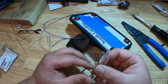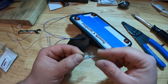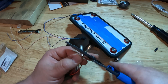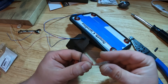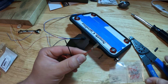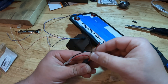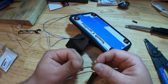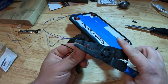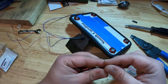You're going to take one of your resistors — obviously you're not going to be able to squeeze a tiny 24-gauge wire into that connector, which is why they supplied these. What you're going to do is snip off the ends of the resistors — not the plug on the receiving end. Slide the boot off, you don't need that anymore. Slide it off just like that and keep the ends — they'll plug in. This one is a 22-gauge wire so it's pretty close. Strip those back a little bit to give yourself something to work with.